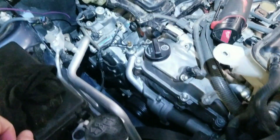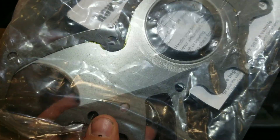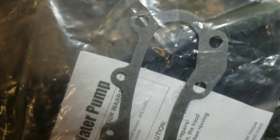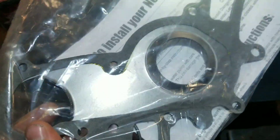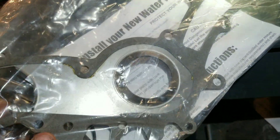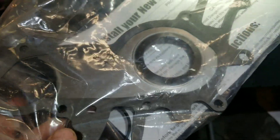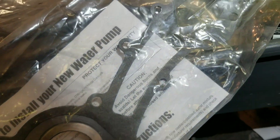I don't have the old gasket around here, so I went and found another brand new gasket that we had in the kit. I bought a rebuild kit — it came with the gasket — and I bought a water pump, and it came with the gasket too. It's a piece of metal with a gasket bonded to each side of it. I don't know why it's leaking, but I didn't put any sealer on it at all. Maybe I should have, but I had two nice clean sealing surfaces, so I didn't think I needed sealer.